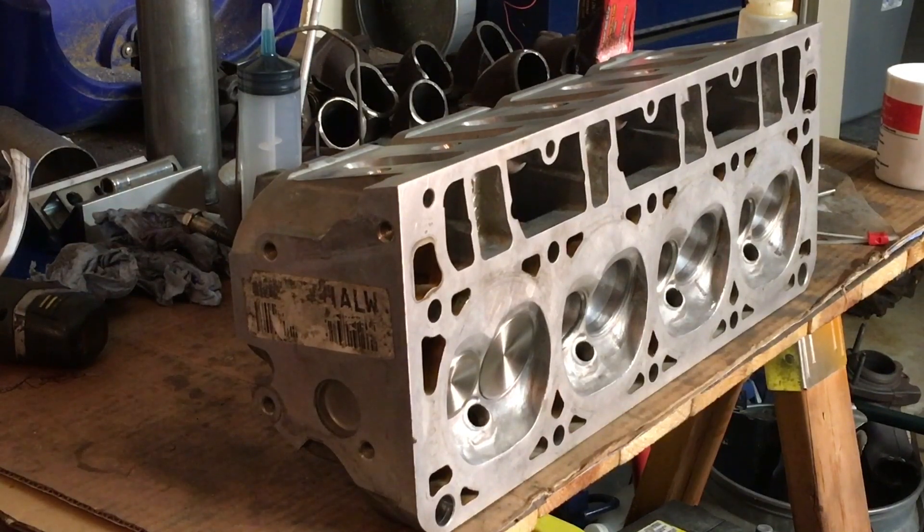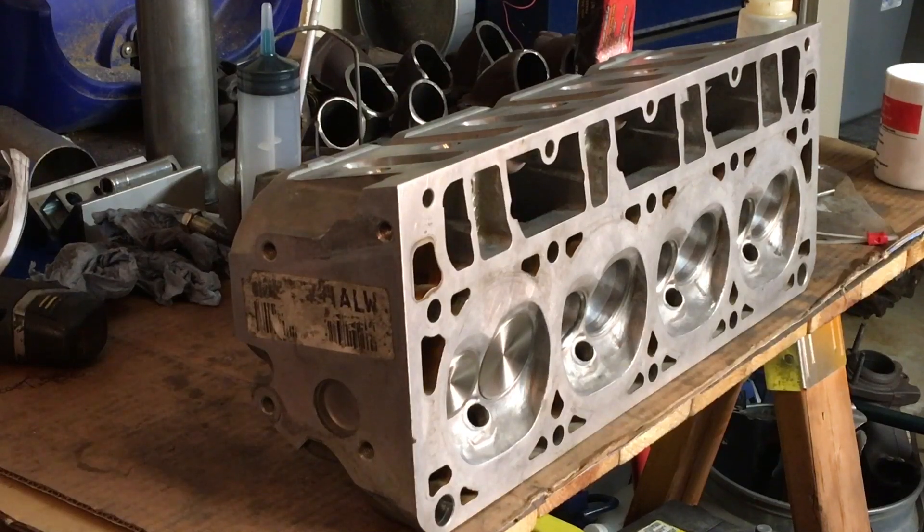Maybe it's a fluke, but I just wanted to share this with you guys. It was kind of a test we had discussed and I decided to just go ahead and try it, throw it on video and see what kind of feedback we got. If you guys have any feedback — positive, negative, sideways — what do you think about going 20 thousandths bigger on intake and exhaust, lapping them in on the factory 2 inch 155 seats, and having them seal perfectly and pass both tests? Hit up the comments, let me know any potential concerns, downfalls, pitfalls, and warnings. Thanks again for watching — please like, subscribe, and share.